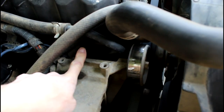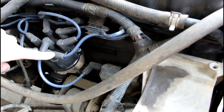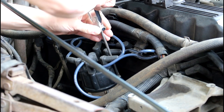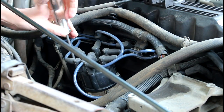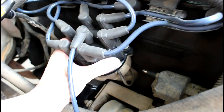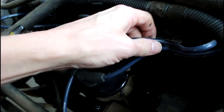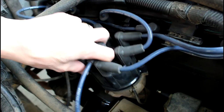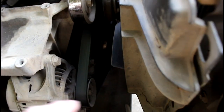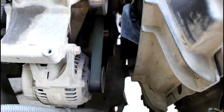Cylinder number 1 — right there. Follow that spark plug wire back. So this is the spark plug wire for cylinder 1. We need to find top dead center on the compression stroke because we want the rotor lined up exactly with this spot. Let's take the distributor cap off. Let's take the wire off to the coil here. Now we can lift the distributor cap up out of the way. You want to leave all your wires attached — you don't want to get the order messed up. Just kind of pull it up out of the way. Now we can see the rotor. The next thing we need to do is rotate the crankshaft down here on your vibration dampener. That's why I'm going to take you into the Project 92 YJ so you can get a little better view.